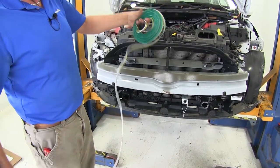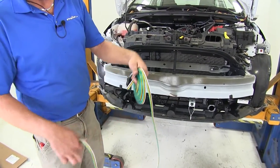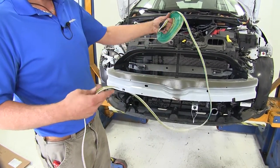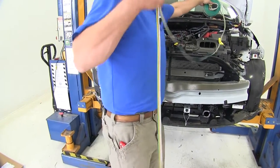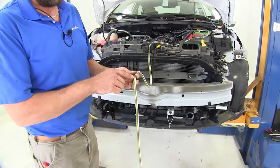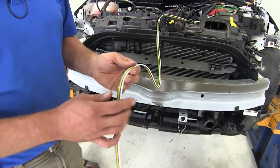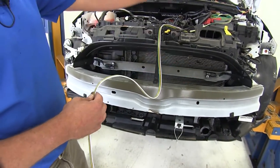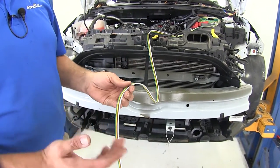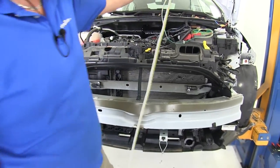What we're going to do is take off that long roll — it's going to have a four-pole plug at each end. Take off just what we need here; that should be more than enough, maybe six feet or so. I'm going to lay the rest right up here on top of the battery. The braking system we're using today requires a couple of connections with our ground wire, yellow wire, and green wire, so I'm going to loop mine up to make that connection and then back down. If your braking system doesn't require that, you can just run this straight underneath the vehicle.